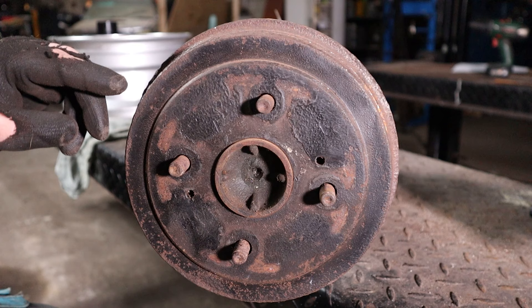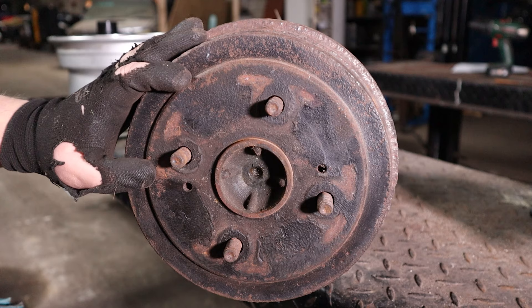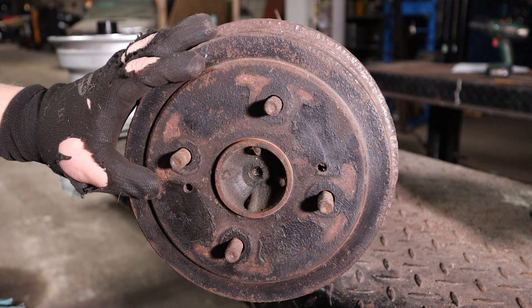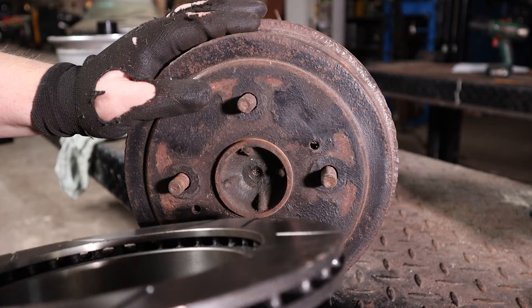Of course I'm going to test that later on, but if it is going to be a big deal then what I'm going to do is make some spacers behind the pads, behind the caliper itself. I could get quite a variety of different pads. For the rotors it is a bit more tricky, but I could get the same Brembo disc I have for the front, so I am happy with that. And it's going to be vented. Yeah, I know it's quite an overkill but hey, if it fits it fits.